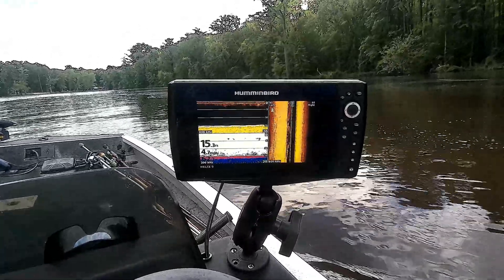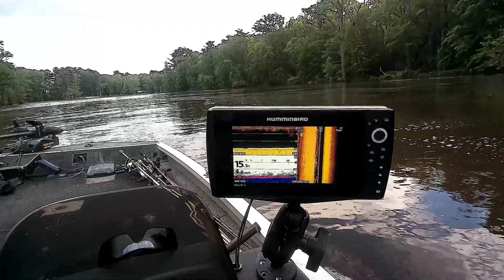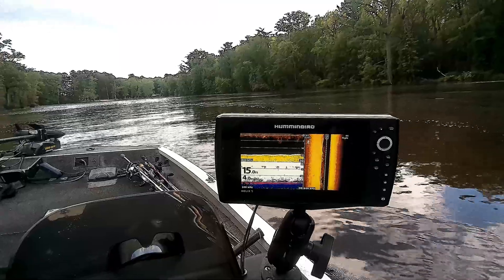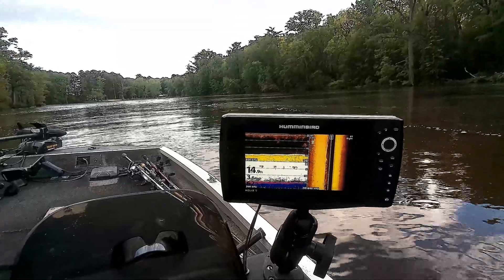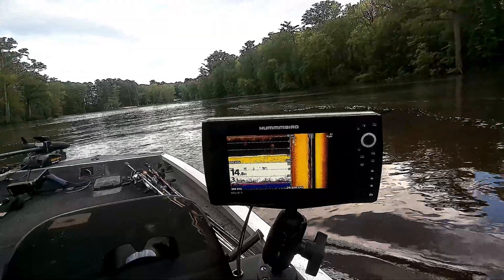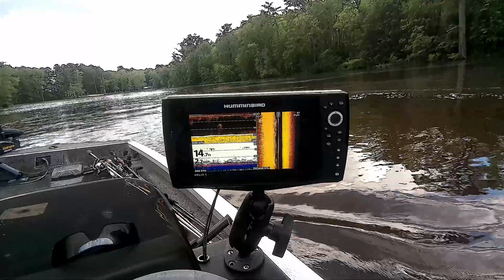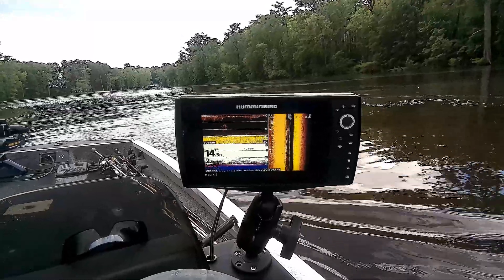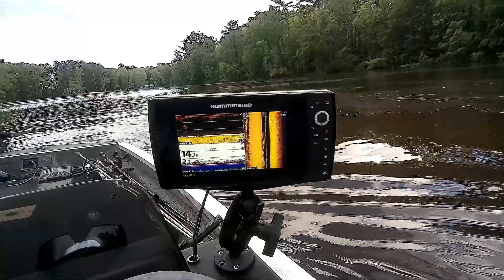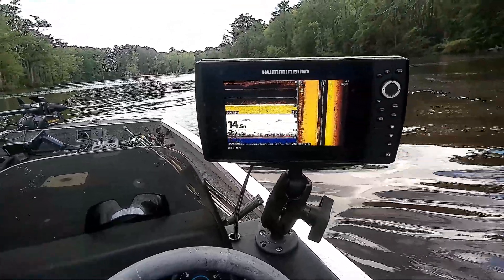Pretty disappointed. We're going to run it back up toward the no-wake zone and see if we can get any more than that — maybe it was a fluke, but I doubt it. After this I'm going to put the hydrofoil back on that we installed initially and see if that picks the motor up a little further out of the water. Maybe that'll work better with the nine-pitch. With the 10 it hurt but it won't take but a second to try it.